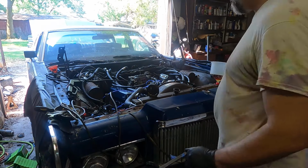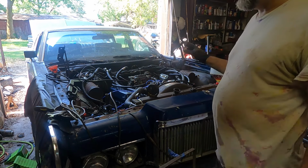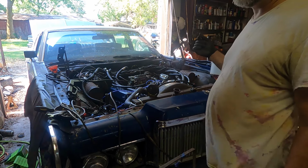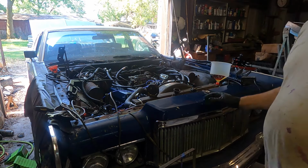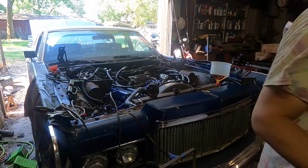And I think I've got the idle, this is a different carburetor, but I think I've got the idle set up. What we're going to have to do is immediately after we start it up, bring it up and vary the RPM between 3,000 and 1,500 gradually for 30 minutes. That's the cam break-in for this camshaft, what they recommend. And we've got, I think it's Lucas, yeah, Lucas break-in oil in it. So let's get this thing started.